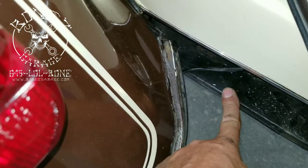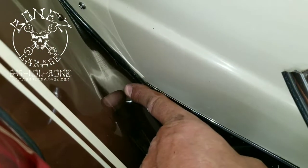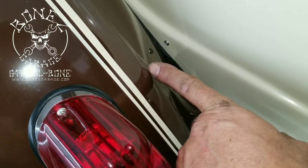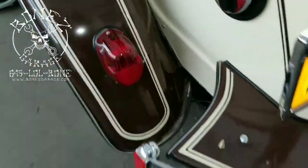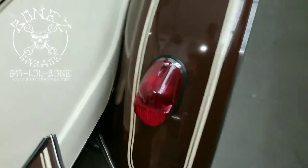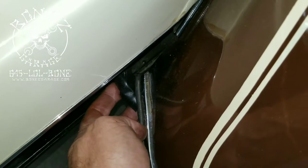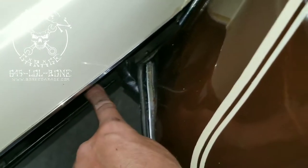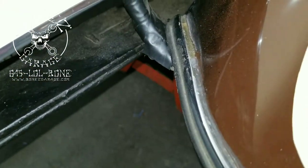It went right over here and it was rubbing against this leaf spring. So we're going to take that, cut it in half, send it through the body and then through the fender, and put a mount somewhere over here with a nice acorn screw, then put it into the tail light so it's safe. We're going to do the same thing on the other side. I can barely fit my finger between the electrical wire and that leaf spring, so I really want to get that fixed.